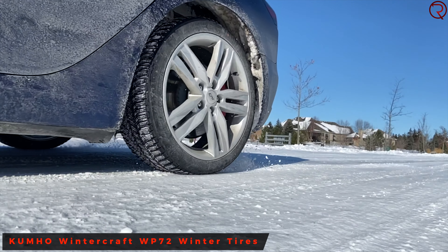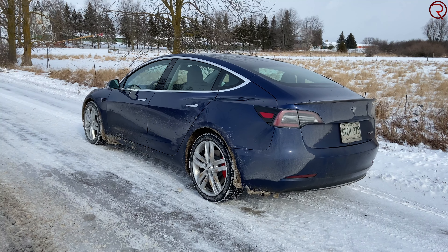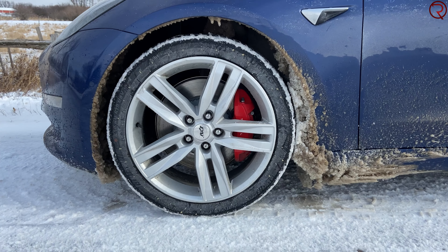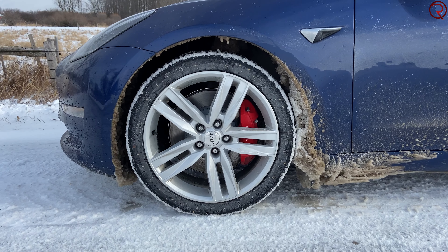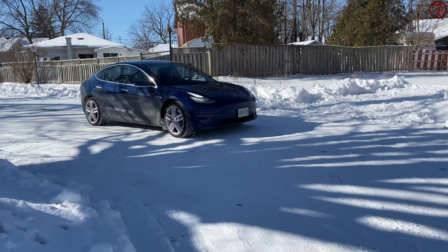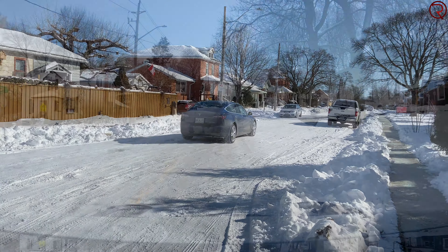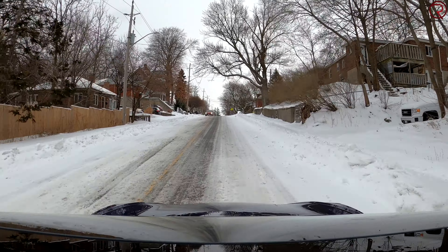This is the first car I've had with all-wheel drive — all the cars before either had front-wheel drive or rear-wheel drive, and it makes a huge difference, mostly when taking off for the first time, because that's the most difficult thing to do on snow and ice. The Model 3 has an open differential — one on the back for rear-wheel drive, or one on the back and one on the front for all-wheel drive. Before I bought the car I was a bit concerned about the open differential.